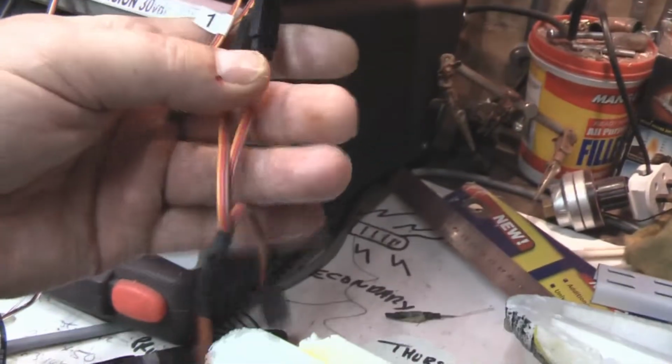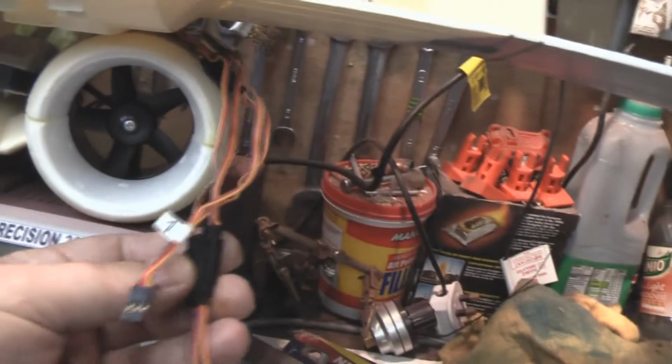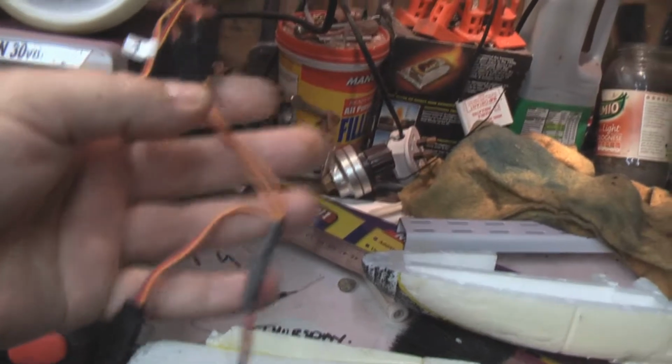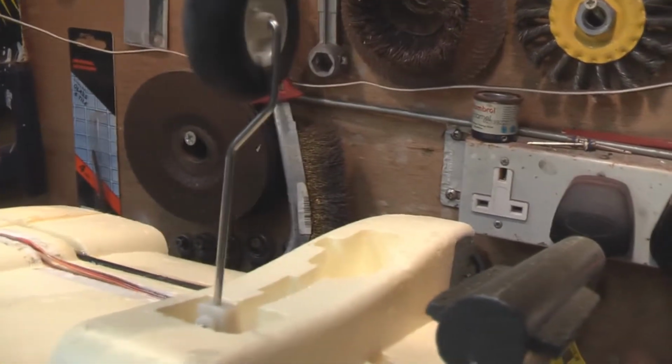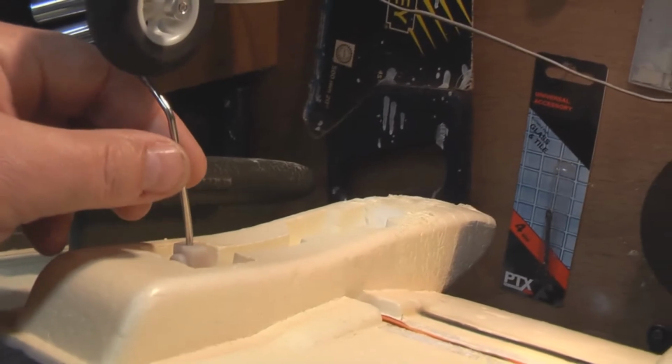and it's an ideal bit of kit to have to try and identify the bits and pieces that come through the fuselage that you're not sure what operates what. But that's ideal, because what I can do is a slow retract on these two wheel assemblies, and then, like I said, take this one out and straighten it and then replace it.